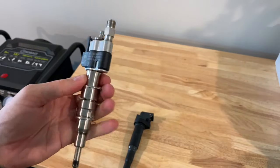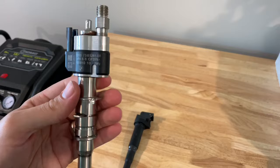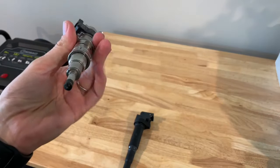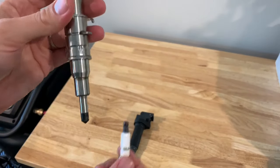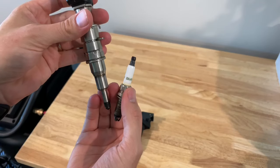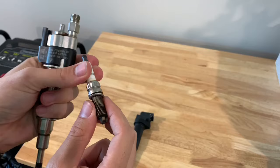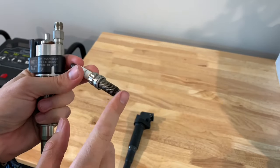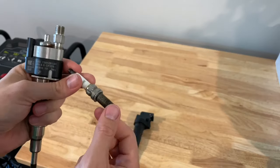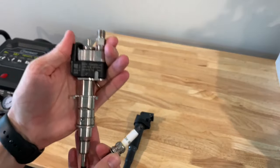But here's going to be the big kicker: your N54 injector. These are my old injectors — I swapped them out for brand new all six Index 12s because I was having fuel mixture codes. As you can tell, these tips get pretty bad. When you pull that spark plug out of number three, go ahead and smell it. If you have any kind of fuel on there, it's obviously fouling out the spark plug, and that means it's going to misfire. If it's getting wet with fuel, it's not going to fire correctly. So if that's the case, you know you have a bad injector.